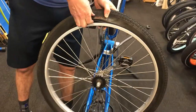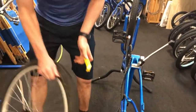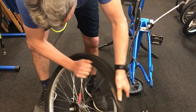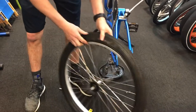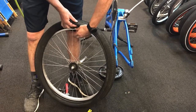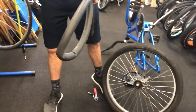Typically you can just peel the tire off with your fingers. Sometimes you might want to use tire levers, like these guys right here. If you did want to use these, you just go ahead, pop it in there, bring it all the way around. Grab the tire at the tube, pull it out of the rim. Try not to pull out the rim tape. Pull the tube on out.